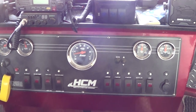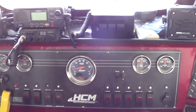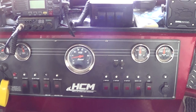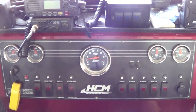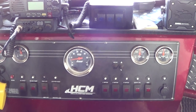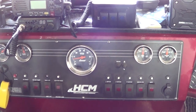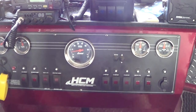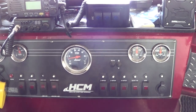Because the power requirements of these lights are kind of bullshitty — the advertised specs are just not correct — you probably want to get the lights, figure out how many amps they draw, and then decide how big the wires should be, rather than going by the published ratings. If it says 500 watts, it's nowhere near 500 watts. So you can end up with much smaller wires than you think, and you won't have to add a bigger alternator just to power your lights. You can figure out the amperage using an amp meter, or just put a fuse in line and see how small a fuse you can go before it blows — then you know about how many amps the system is drawing.